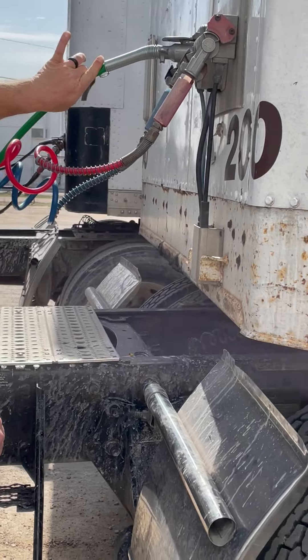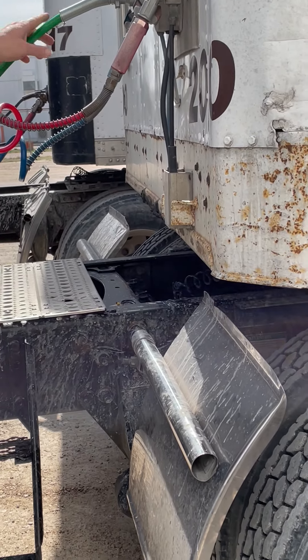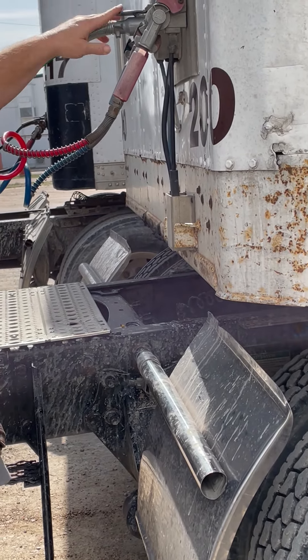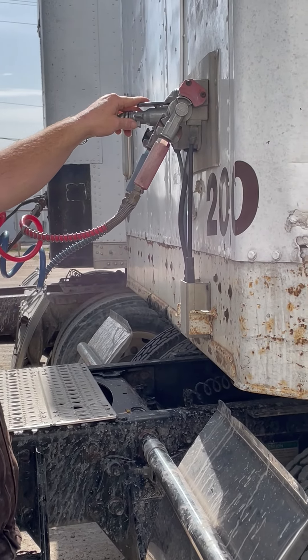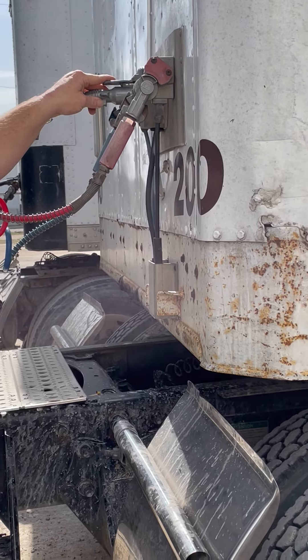My electrical line — properly mounted, secure, not ripped, torn, or frayed. If the safety latch is in place, I would pull this out and make sure that my seven holes are free of debris and my seven pins are present, not bent or missing.